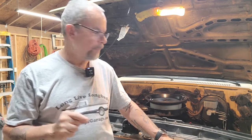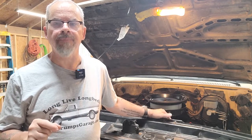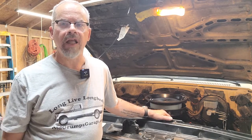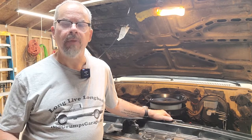So what I've done is I've ordered a new shroud, because this shroud's smaller for the V6 radiator, and I've ordered a new aluminum three-row radiator that is the dimensions of what this truck would have had if it had come with the V8 from the factory. So we're going to upgrade that and we're going to do some monitoring.